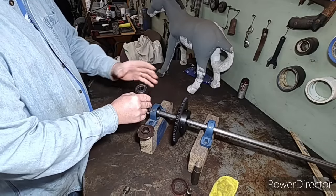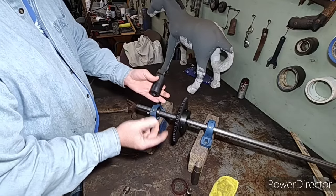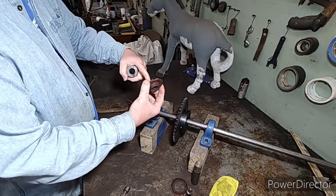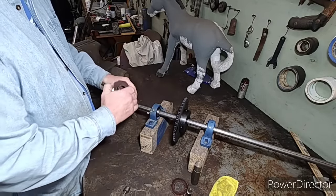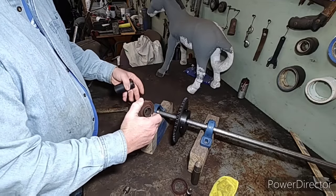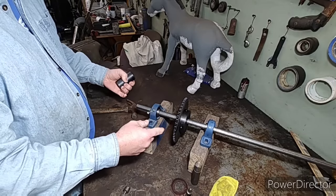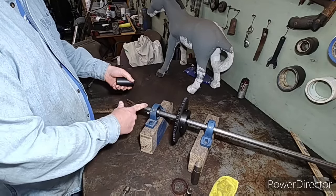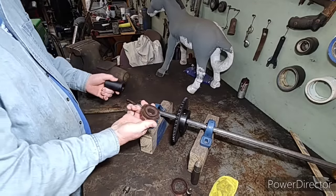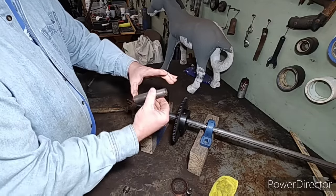This one is three-quarter inch — for all my input shafts I build I use one inch, but I don't have any one-inch stuff on hand, so it's identical except for the bore size. The splines are how you go from the transmission shaft to all your new stuff. I use one inch because there's so much stuff available and it's the cheapest and easiest to find — a one-inch coupler, a one-inch shaft, one-inch bearings, and one-inch hub sprockets.